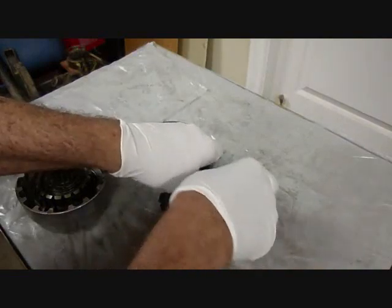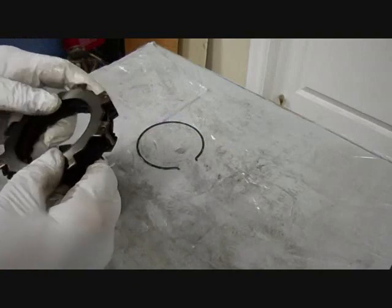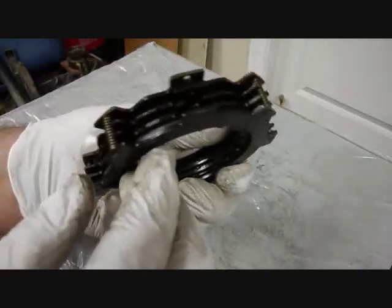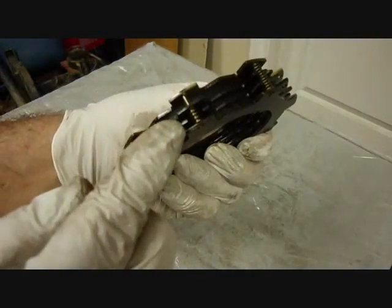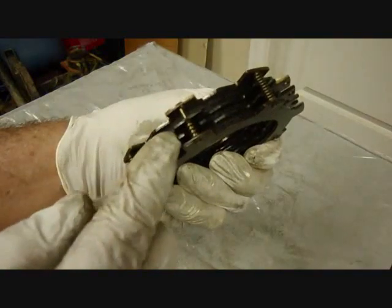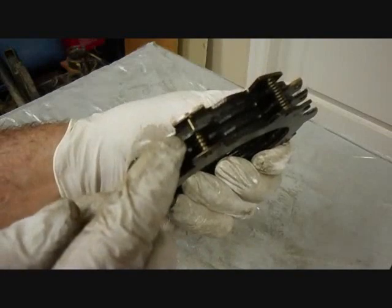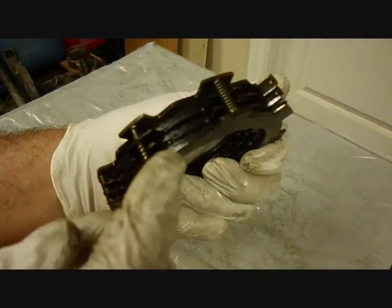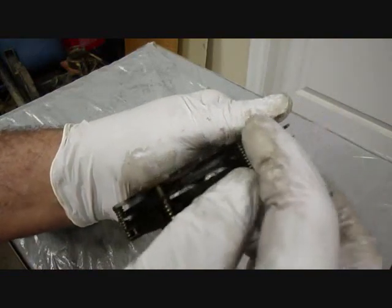And if you can't remember the order of those things, you can kind of look in the end and see that there's a reason for the long and the short screws and everything. Long and the short springs. The short spring reaches through and it'll separate the middle of the steel plates, okay? And then the longer one spreads the open one, the top one.